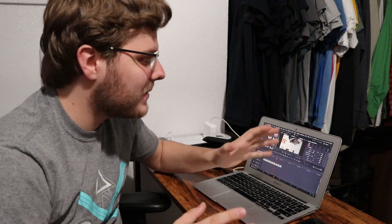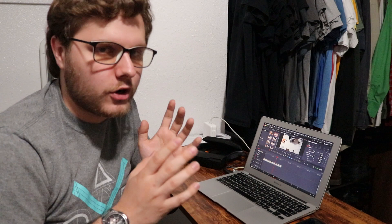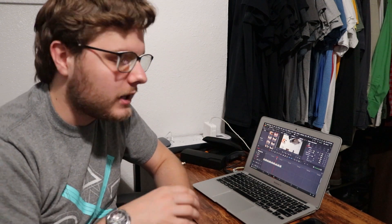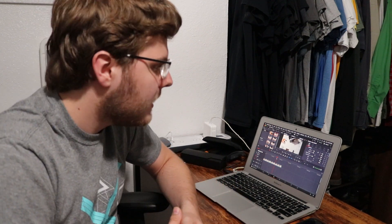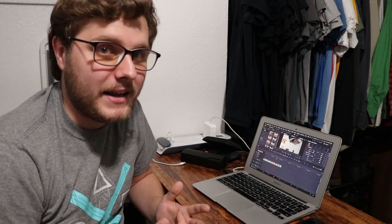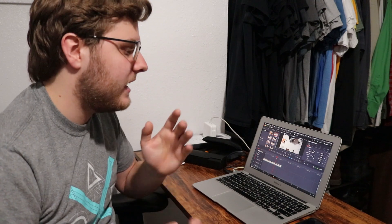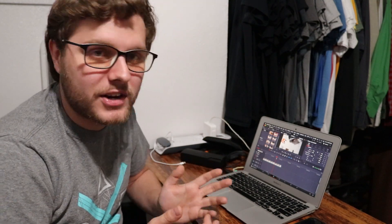So I'm editing the footage and I realized I don't have the footage of me cleaning off the circuit board, the disc tray, the fan, all that stuff — I don't know what happened to it, but it's gone. Essentially, I took a mini compressor with a basic air nozzle and used that to spray out all the big clumps of dust. A can of compressed air works just as well. If you're using a compressor, make sure it's on a low setting so you're not damaging the board. Then whatever dust was remaining, I used a small soft brush and a microfiber cloth to clean it all off. I didn't go in-depth cleaning anything — it was mostly just a lot of dust. Then I started reassembling it.